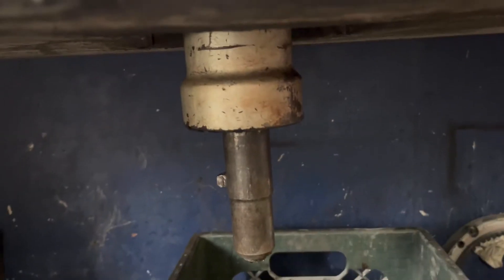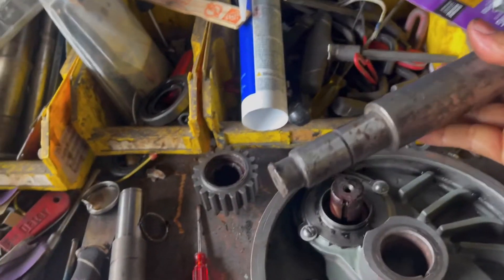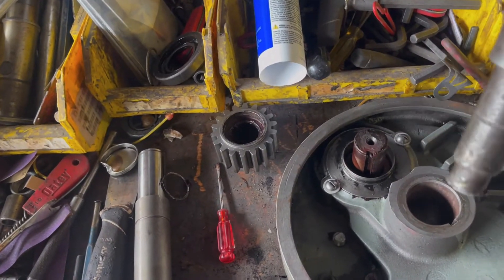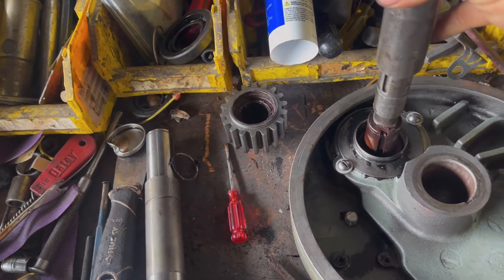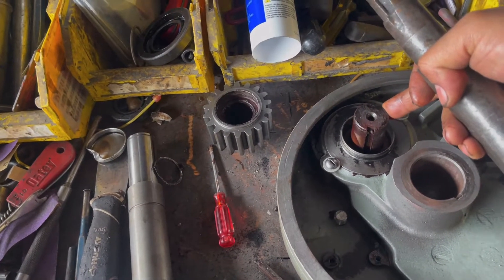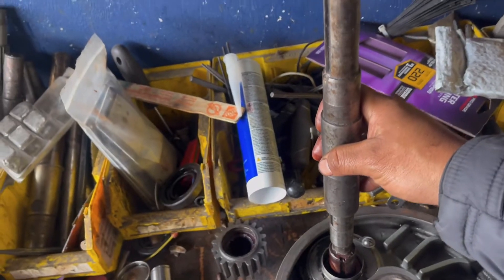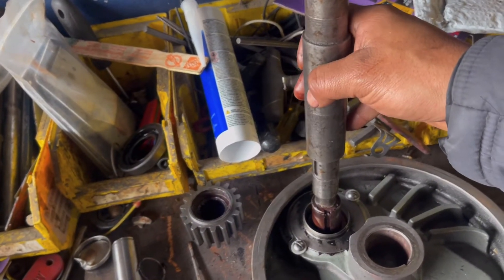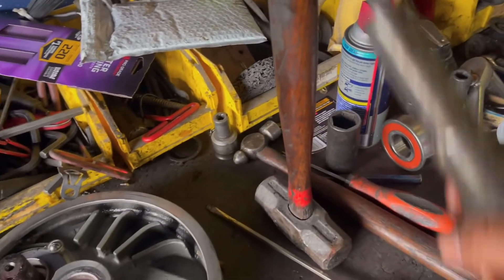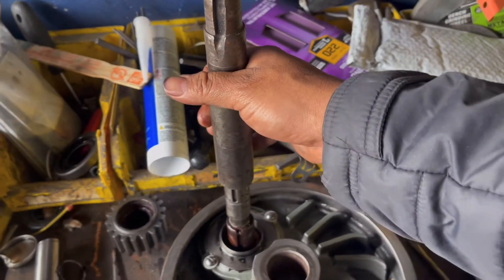I have a table here that allows me to sit the planetary flat. This table has a hole — this is where the magic happens. I use a piece of bar and try to position it in the center so you don't damage the ends of your planetary. You need to be in the center with anything you can find, and just tap it out — that's it. That's the tool you need; there's no other way to get it out, at least that I know of.